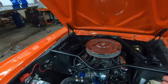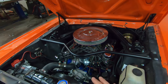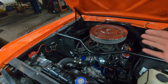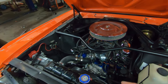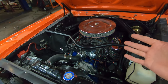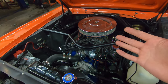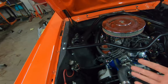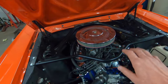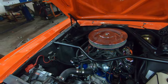You've got to raise your RPMs up a little bit and make sure your timing is set. I had my oil pressure gauge on it, my vacuum gauge on it, and my timing light on it — all things I'm watching and monitoring to make sure everything is good. I like to have about a half hour of run time above 2,000 RPMs on a fresh rebuild, especially with a flat tappet camshaft. After that, I dump the oil out, change it, change the filter, and we're good.